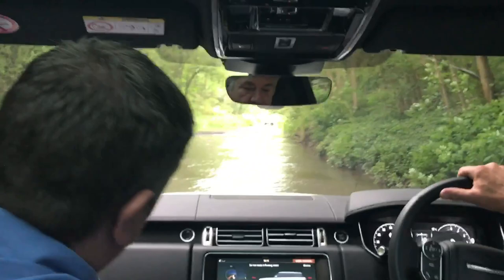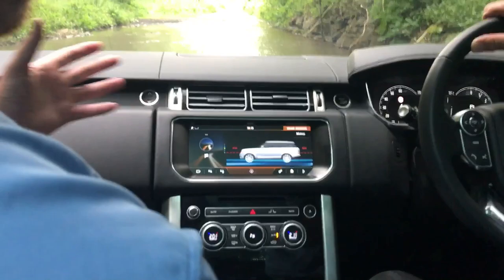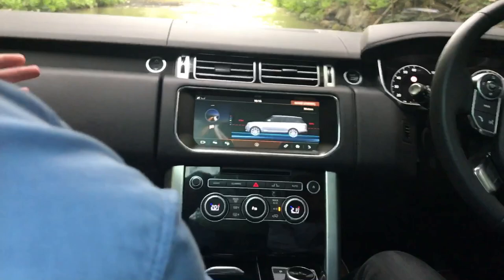What we don't want is to go through too fast — you can see that we're well within our wading depth. When we come back in, it's quite deep water but it's well within it. The faster we go, the more we're going to create a bit of a wave, and that could be affecting the track here, any wildlife habitat, or other road users if we're driving down streets that are flooded.